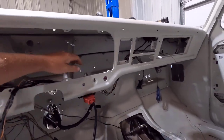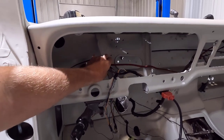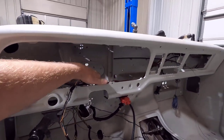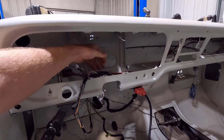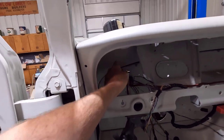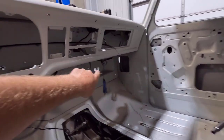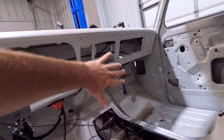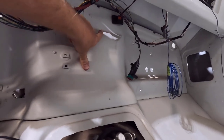I've shortened up the harness a lot and routed things a bit differently than the Power Stroke truck was routed. Mainly this big cable that feeds the BCM — I don't think it needs to be that big since the BCM basically doesn't do much of anything anymore, but that's just what the wire goes into the plug, so that's what I used. I routed it over here because there's very limited space over there with the AC box up against the firewall — it takes up pretty much all the flat area where I could put bulkhead fittings.